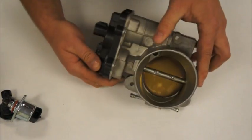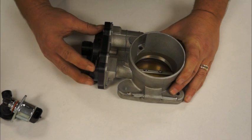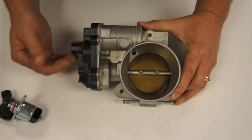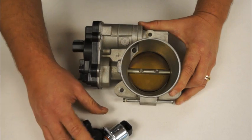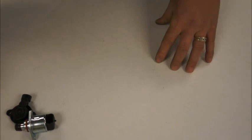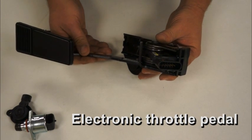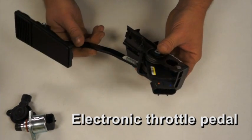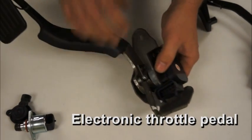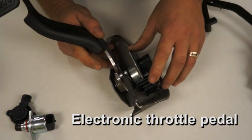You may end up having an electric throttle body on your engine. This has a side plug that goes on and is electrically controlled by an electric throttle pedal. That electric throttle pedal is going to open and shut the throttle body as necessary to allow airflow, and the engine does basically everything that the IAC and TPS sensors do — right off the computer brain. You're going to have typically several different kinds of throttle pedals. You'll notice that the older style throttle pedal pins typically have nine pins, and the later model ones have a six-pin plug.